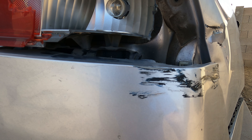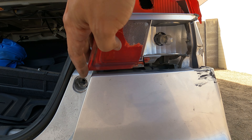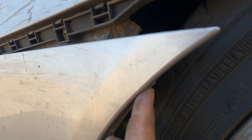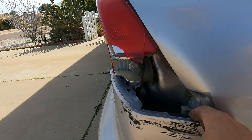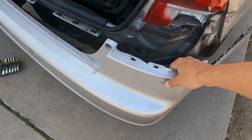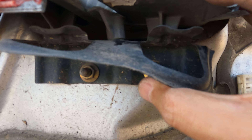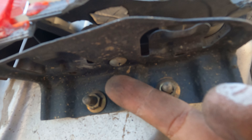I've taken off the front bumper many times on this 7th Gen Civic but never the back bumper. Looks like the taillight is mounted into a bracket back here, which means you have to take off the bumper. You've got to take off the bolts on both sides right next to the taillight — two bolts, one on each side. Also, there's a bolt and a screw that mount in here as well. Once you get those off, it should come right off — and there we go, we got it off.